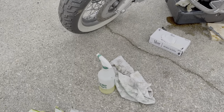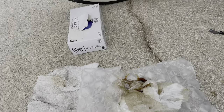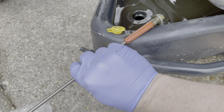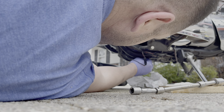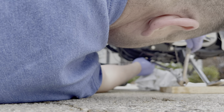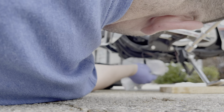As I spilled a little bit, I got some Simple Green and some dirty rags. So as this drains I'll go ahead and clean up. One of my favorite tools — a magnet. Let's go fishing. There we go, I got the drain plug. It stopped draining, so I'm going to put the plug back in underneath it. I caught the oil. I cleaned off the plug so there's no residue there. Getting it in hand tight. Not too tight. That is done.